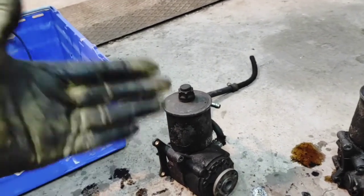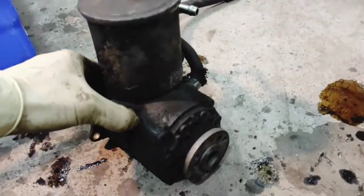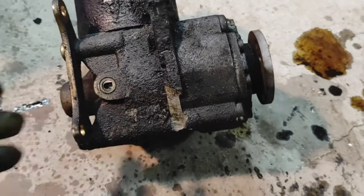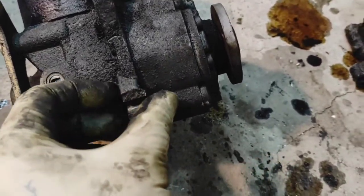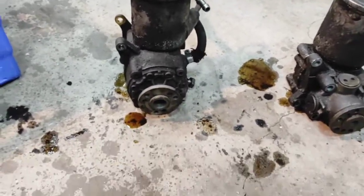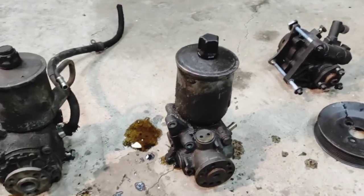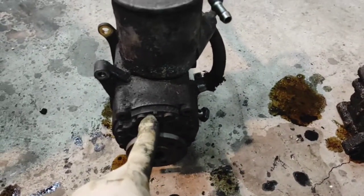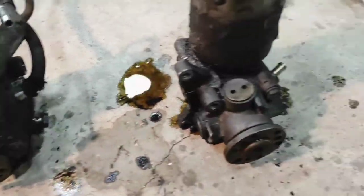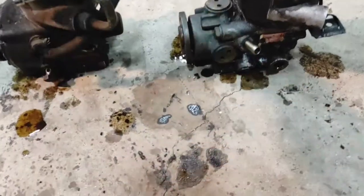Why am I doing all that? There's a lesson here - someone told me on YouTube and he was dead right: this one had the auxiliary belt jumping around because the tensioner was worn, and as a result it had snapped that bracket clean off. He'd warned me this could happen before I even saw it. When I loosened that bolt, it just fell loose - so I cannot use that one. There are also slight differences in chamber size, which may relate to rev range: the lower-revving diesel may need that bigger chamber.